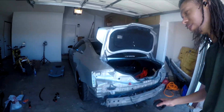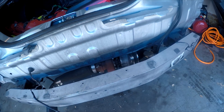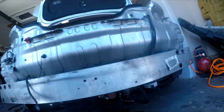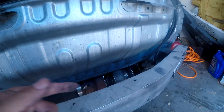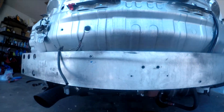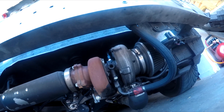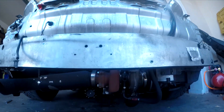I'm going to take his advice and try to fix that issue. It's going to deal with moving the scavenge pump and putting it in a better position so that the oil can flow better. My lines might be a little kinked, so I'm going to do some adjusting to make this line not have to fight gravity as much. This pump does a good job pushing but not so much sucking. You can see oil is building up right here — I don't think the turbo seals are bad. It's a MaxSpeeding Rods turbo and I think it's just the oil backing up.